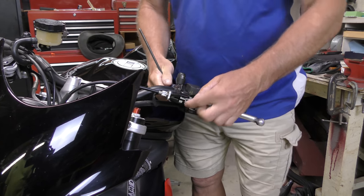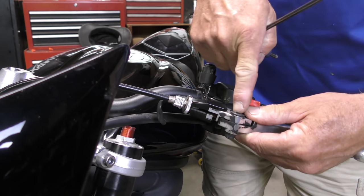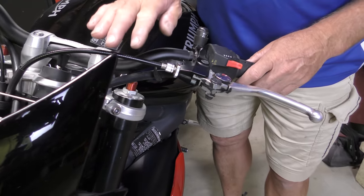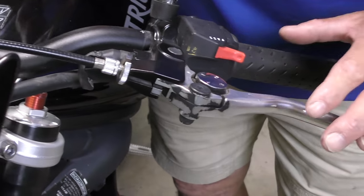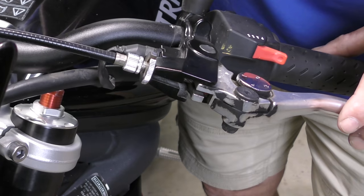The first thing we're going to look at is right in here — this gap. The clutch lever hits the perch. What we're looking for, especially when the bike is hot because this is the best way to do it, is a gap of 1 to 2 millimeters. As it's currently set, that's a little more than 1 to 2 millimeters.